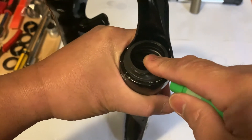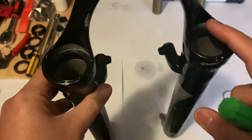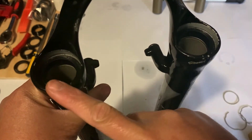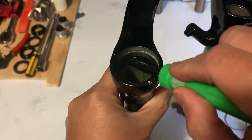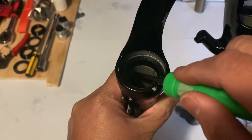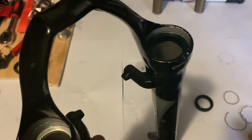Put the screwdriver on the second groove and pry this out. You'll see a retaining spring in there — put the flat screwdriver in, pull out the retaining spring, and put it aside. Now that both the dust cover and the retaining spring have been removed, we can now remove the oil seal. Since I'm already removing all the parts out of this lower, I'm going to change both oil seals together at the same time. To remove the oil seal, use a flat screwdriver positioned right at the bottom of the oil seal. Be careful not to contact the pilot bushing inside. Go underneath the oil seal — there's a round washer — place the screwdriver right above the washer below the oil seal, give it a firm lever up, and the oil seal can now be removed.